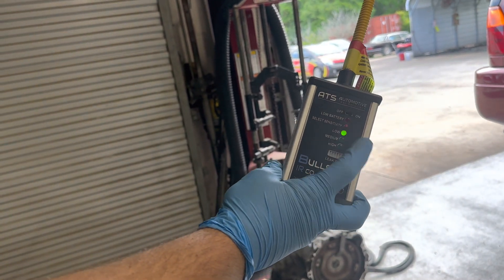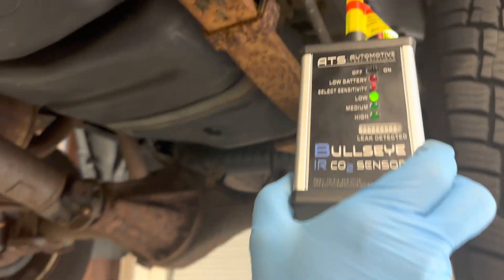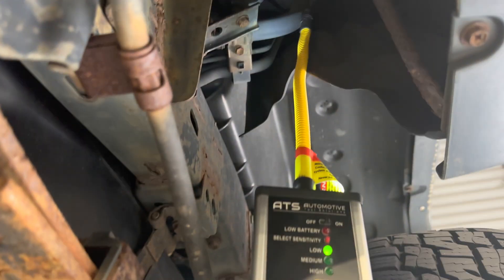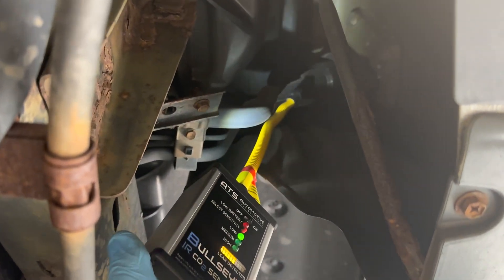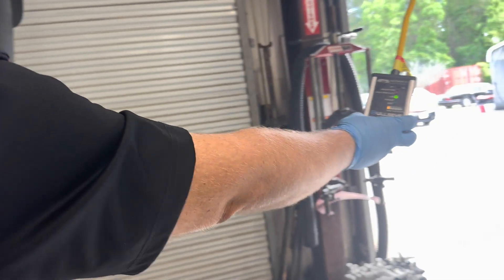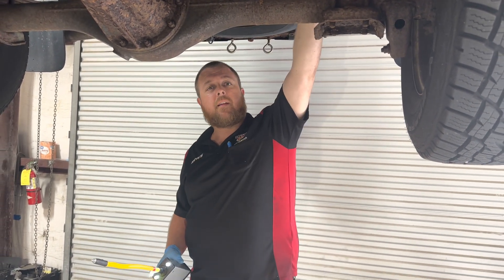Bring the sniffer outside of your affected area and let it recalibrate — you do not want to hit that button again. Let it reset itself, and I always like to double check. We've got a leak in the filler neck area. You can actually smell the fuel on this one too. In the filler neck area, you've got the filler neck itself that can leak, and you've got the gas cap. I have already checked the gas cap — it is sealing. The vent valve hosing empties into the filler neck area.